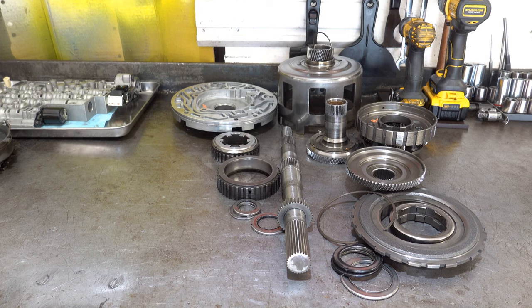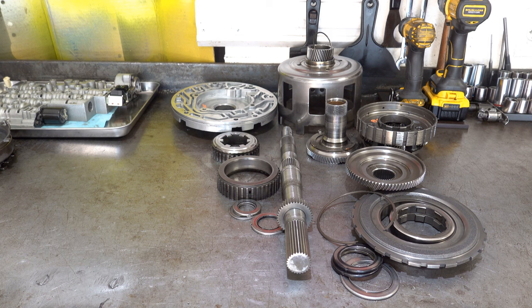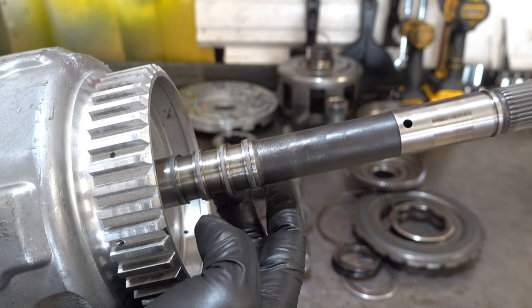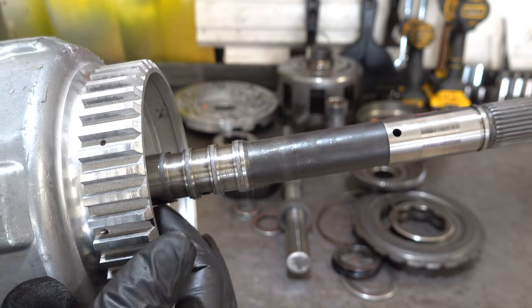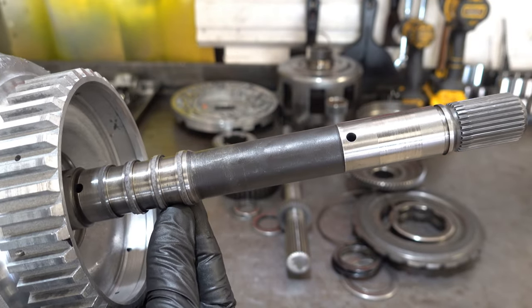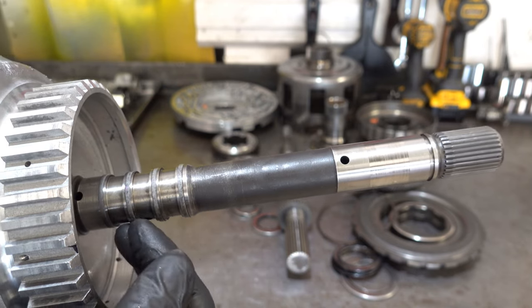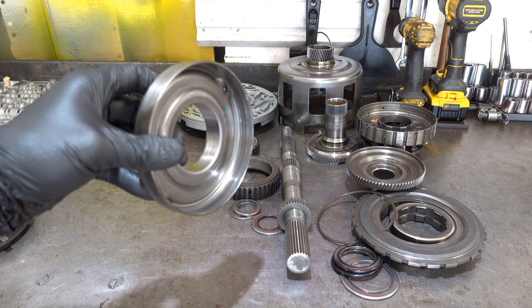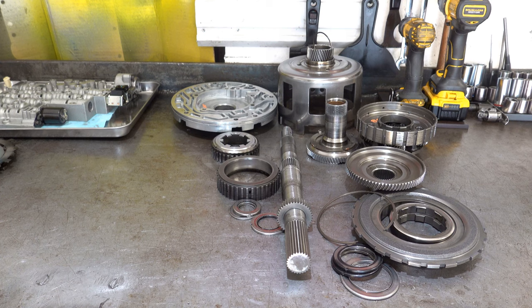All right, this fits the evidence because if we take a look at the sealing rings on the input drum, none of the sealing rings are damaged. If we had damage to either one of these sealing rings, you would see the adjacent clutch also burnt up, right? You would see the 3/4 smoked if this sealing ring was bad. You would also see the coast clutch frictions burn up if this sealing ring was bad, because you'd have leaks in either of these two locations. That didn't happen. We didn't see those clutches burn up. Whatever caused the failure was confined to the forward clutch circuit, and it didn't involve sealing rings. So the only place left that we can really consider is the forward piston housing. So that's what happened, at least insofar as the forward clutch is concerned.